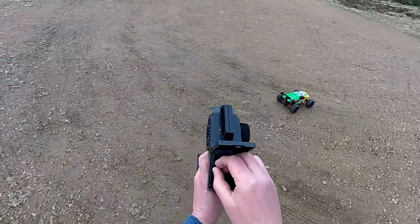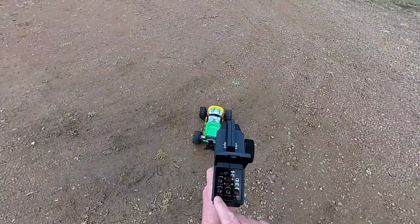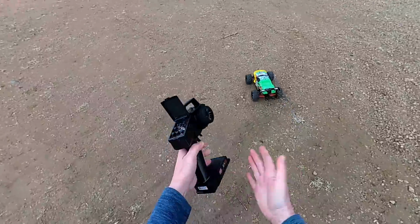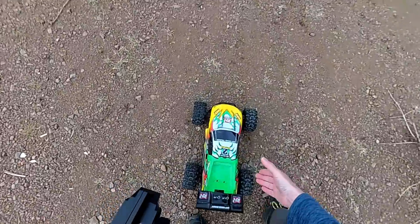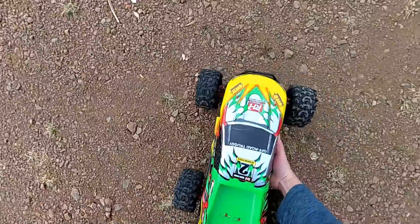Look, I'm going to keep that up at full, yeah. Might as well have a full go with it, see whether it flips over or not. You've got your throttle trim as well. So if this is out, the car's rolling forward, I'm touching nothing here. So you need to get that so it's just not moving. And another way of testing that is just lift it up and make sure the wheels aren't even trying to roll forward.